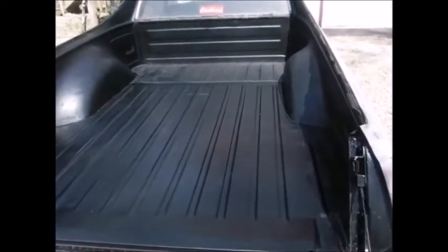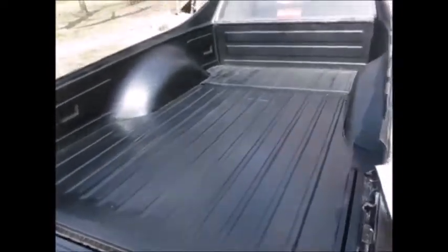Alright, so it's been a slow process, sanding and wire wheeling and all that to get this all sprayed, so it don't look too bad. I welded up a couple small holes, but I still got some spots here, tiny ones down here, that are gonna need fixed. But at least right now, it's gonna slow everything down. I can come in and section out a piece here and weld one in, but at least I won't have to worry so much about this. Just scuff it and shoot another layer or 2 on there a little bit later on. So at least that'll give it more protection than no protection.